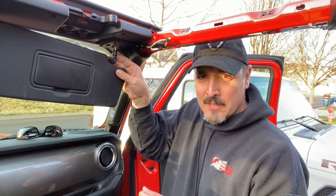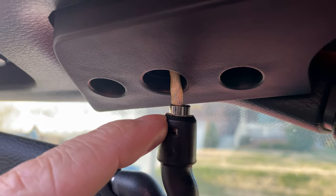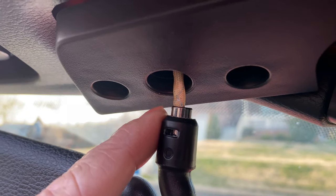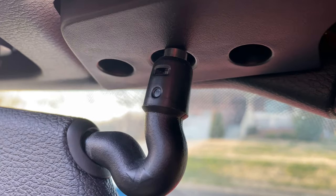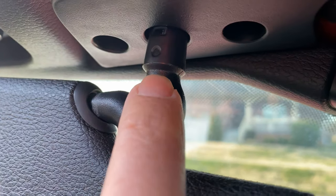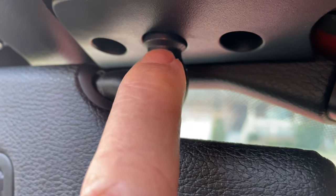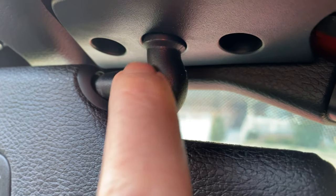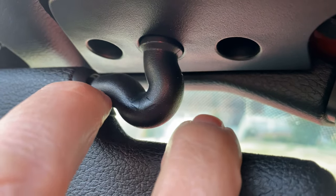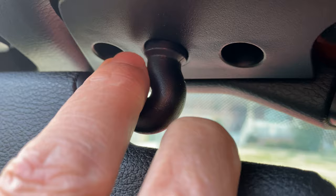Let me show you what the issue is. See where the exposed chrome shaft is? There's normally a piece that comes up and out — around here to where it just goes up and snaps in. What the TACCOM piece does: you see this edge here? When it's up in there, the TACCOM piece bridges this gap and grips tightly around this smaller diameter section of the visor arm. So if it did let loose, it wouldn't drop far — it would catch right there on that edge.